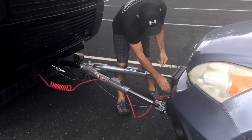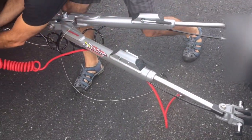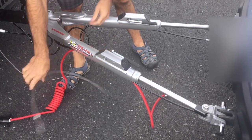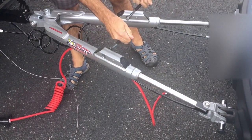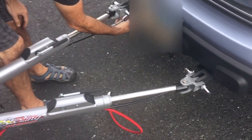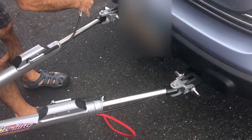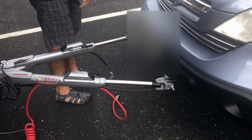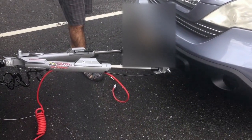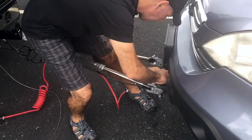Here's a quick clip of disconnecting the car. The first thing I do is put the car in park, then replace the pin on the breakaway cable, then do the electrical cable. Next comes the part that's gotten even easier with the new tow bar: releasing the levers with one finger. This was my first time with the new bar — I didn't believe it so I pulled it a couple of times. Then it's safety cables and locking pins. The locking pins can be the toughest part — they get grimy and a little rusted, so sometimes I spray them with T9 silicone lube.